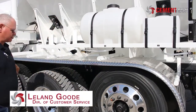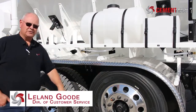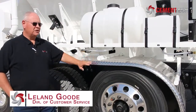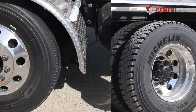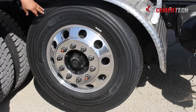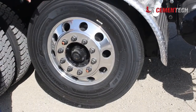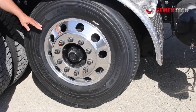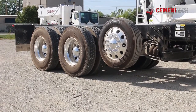This truck, if you look, it's got three axles — your two drivers and your pusher axle. It's air-lifted and air-down. Controls are in the cab on this unit; there's just a switch that lowers it or brings it up, and then there'll be a regulator that regulates the air pressure. To set this axle, once you load the unit, you need to go across the scale and adjust your weight accordingly — your air pressure — to determine the weight you're putting on those tires.